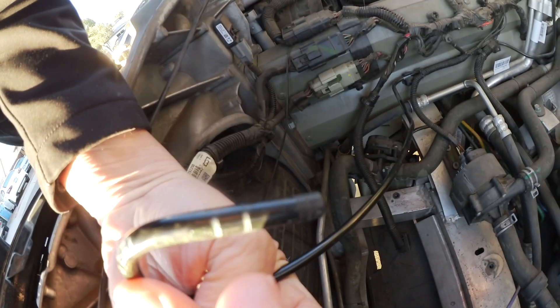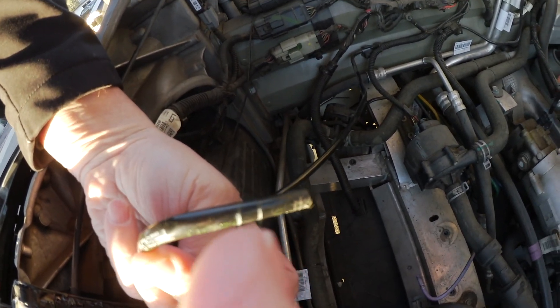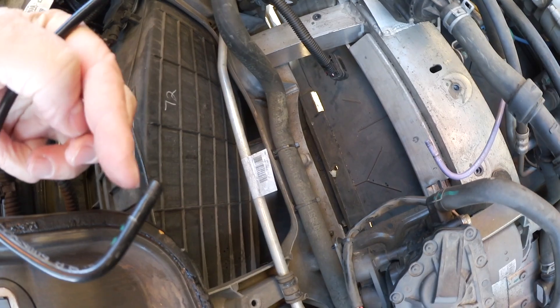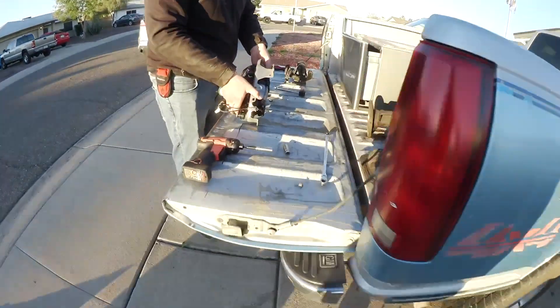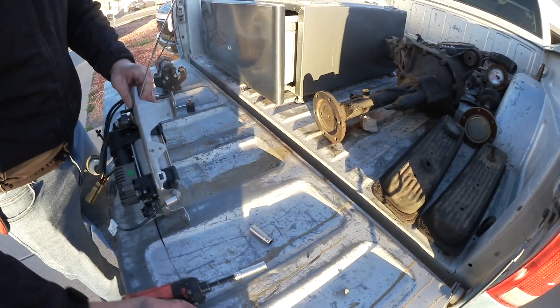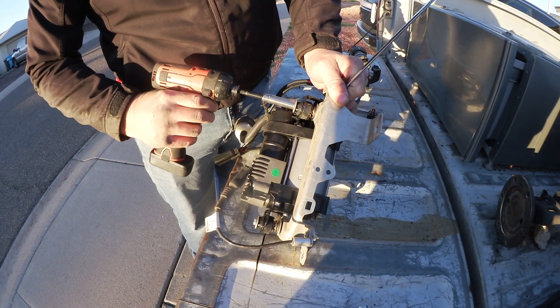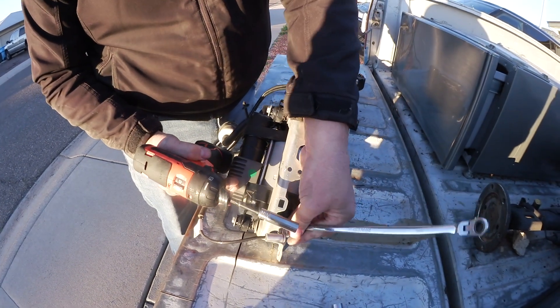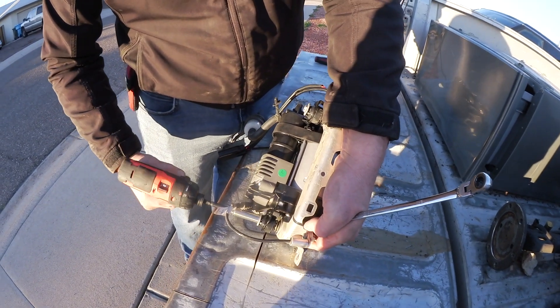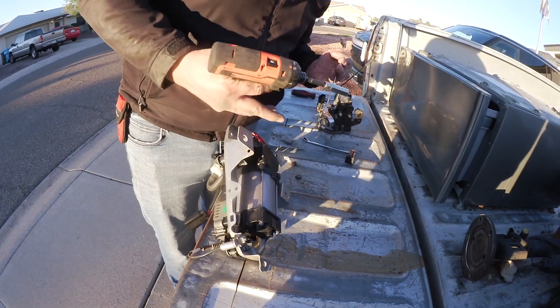There's a very tricky piece when you push the pipe in. You can see here there are two markers — one and two — and you have to push it in between those two markers. If you push them in too wide, the compressor cannot work, because the pressure comes from this side and not from the other. We have assembled the bracket back together with the feathering mounts and then put it back. It's funny that they have one bolt on the other side — all bolts from the top and just one from the other side, just to make it complicated.